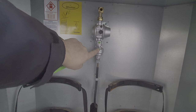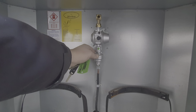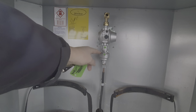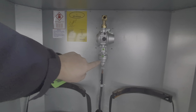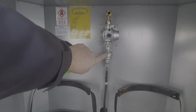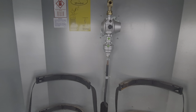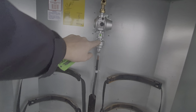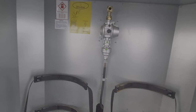There is a further safety mechanism here — a crash valve. It's a bit of a worrying name, but what it does is sense if there's a sudden jolt or impact and switches off the gas supply. When you first connect to gas you'll need to depressurize that valve by pushing the button in. Connect your gas bottles, switch on the tap on top of the bottle, then press that valve in — you'll hear it hiss and then you know you've got a pure flow of gas coming into the motor.